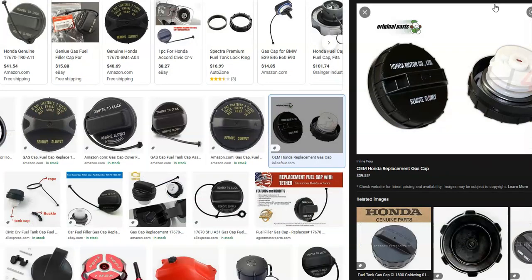Also keep in mind that the gas cap is part of the EVAP system. It needs a good seal so the whole system can go into a slight vacuum for everything to work while the car is running. Be sure to check the gas cap — make sure the seal is good and it's locked in all the way. Usually a bad gas cap would give a different code, but it is part of the EVAP system, so it's worth checking.